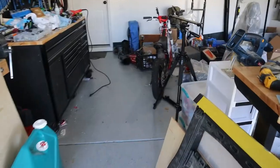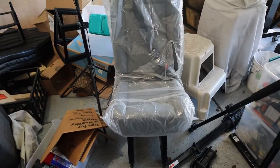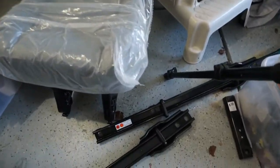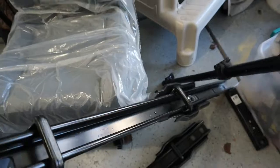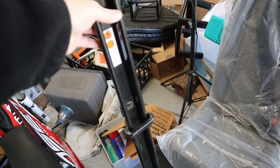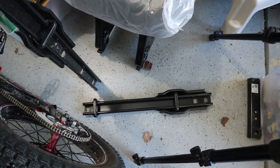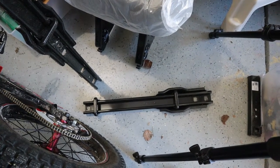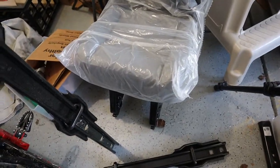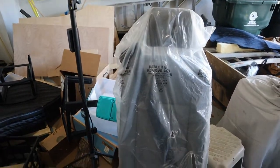The second project is going to be putting a third passenger seat inside the van, and that is going to be a task in itself. I have these brackets that install in the bottom of the van, but my floor is already in, so I'm going to have to cut the floor out and shorten these brackets down so they won't be so long. I've already shortened one with the Sawzall. The seats just clip in, and boy are they heavy. It does have an integrated seat belt so I don't have to worry about anchoring that down separately.